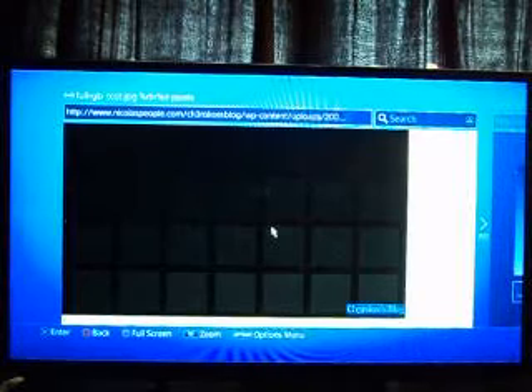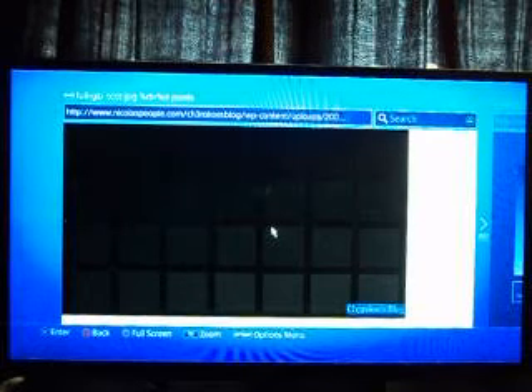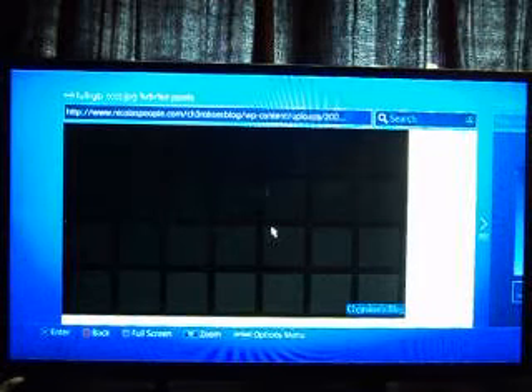There'll be three settings on RGB range: automatic, limited, or full. You're going to want to switch it to full, and then go to this image. On Xbox One, it's going to go from TV to PC — switch it to PC and then go to this image. To see if your TV can even support that, if you do not see this top layer here of squares, regardless, if you go to your actual TV settings and turn up your brightness all the way and still do not see that top layer of boxes, your TV does not support the full range effect.